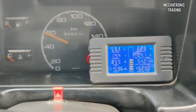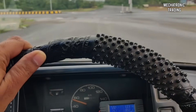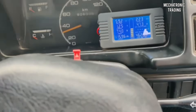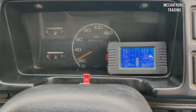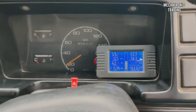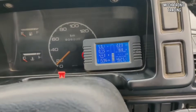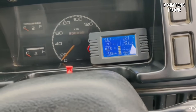I am going to press the brakes more so that the regenerative braking stops now. I am gradually reducing the speed of the vehicle and as you can see the regenerative braking is also stopping. It has gone from 13.3 amps to 2 amps and it has now become 0 because I have stopped the vehicle. This is how the regenerative braking takes place and the voltage of the battery pack increases as the regeneration takes place.